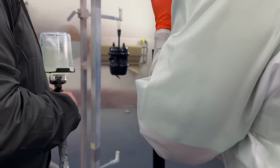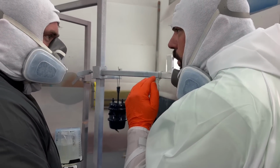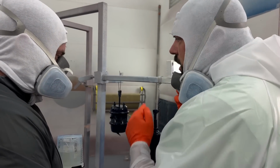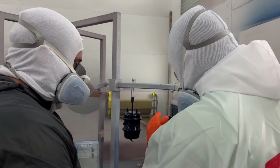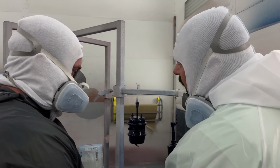Understand how that clear is going to lay, and when you're going to have to run some stuff, to understand where your limit is. It's okay, man. If you run something, who cares? You just learn where that limit is. All clears are different. So once you do run something, you just remember how you were spraying it, where you were hanging out there a long time.